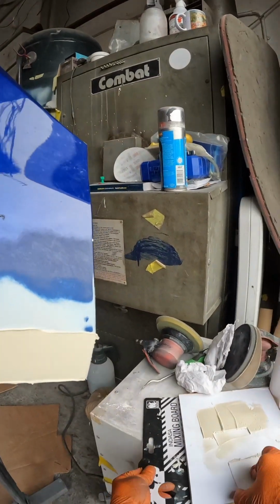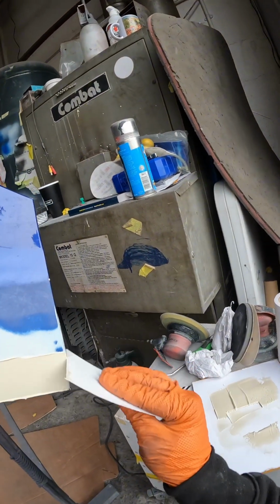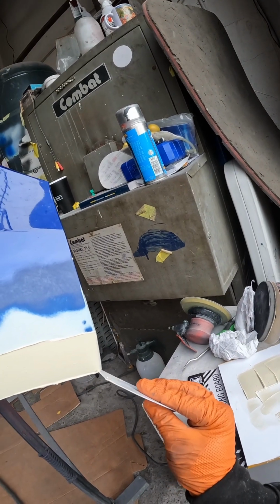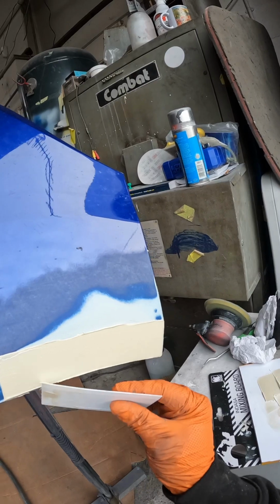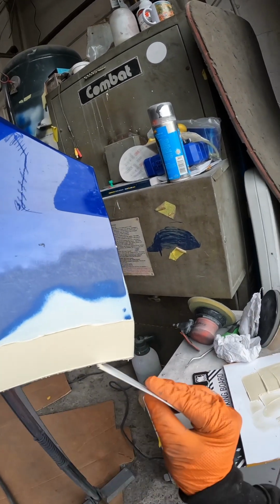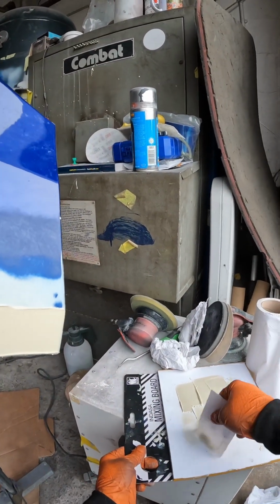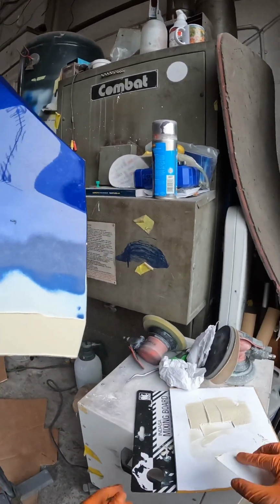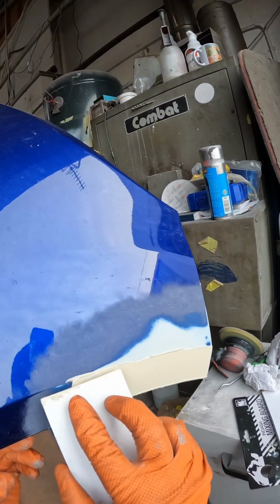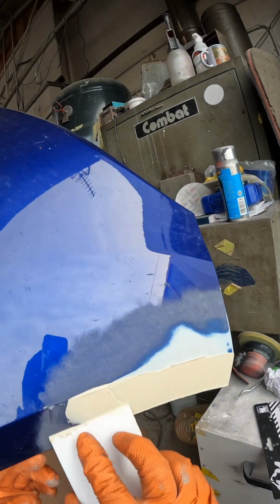Give it a good pull through to even everything out. So, you know, when you get to that stage, you can just rub the spreader along the edge, clean off any excess there. It helps us to bring it back in at a slight angle as well, and that'll just taper it and feather it for you. Ooh, avalanche. And then I'm just going to bring a little bit in and feather this end out just a touch more.